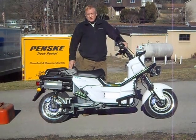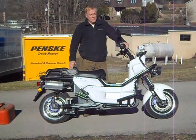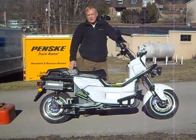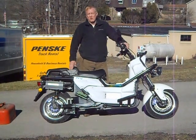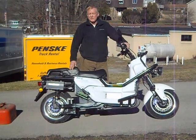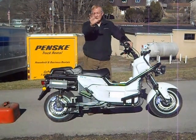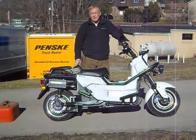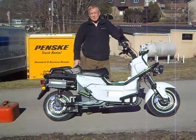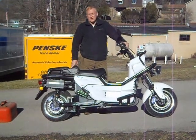One of the features of the Zev is that we run extremely fat tires. We're a typical sports bike-style motorcycle — we carry a front wheel that's a 110 cross-section tire. We're a 130/60/13 rear. That means we've got a tire with a footprint that's wider than your hand. With all that rubber on the road, this makes this bike really good to dive into corners and especially for very hard braking.